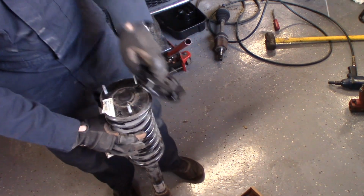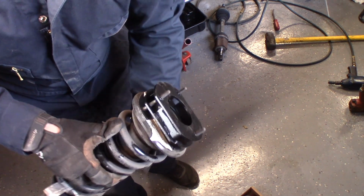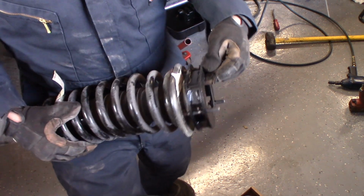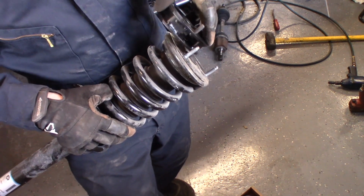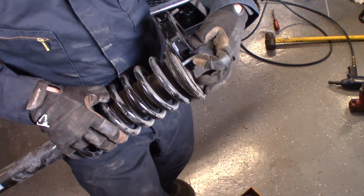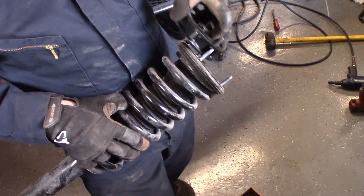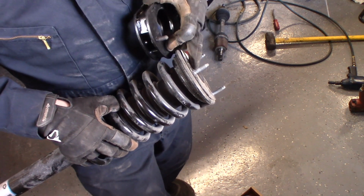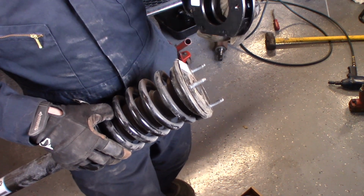On this step here, we take our new mount, put it on top of the strut, but if you look on the side, there's a gap between the strut and the plate. The reason for this is that the bolts are hitting each other. So what I do on the Rough Country for the Jeeps, I set them to the side like this, and I'm going to mark that bolt about right there where that bolt won't hit that nut on top. Set this next to it, mark your bolts, put your nuts on them, and then cut them. That way when you take your nut off, your thread will be good and your nut will go back on easily.